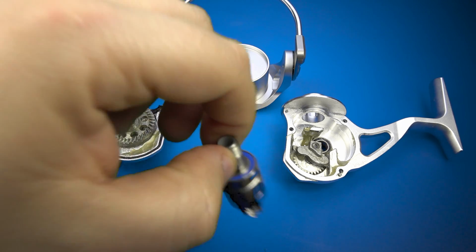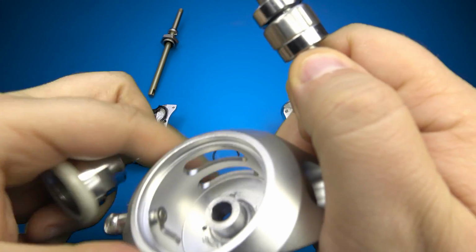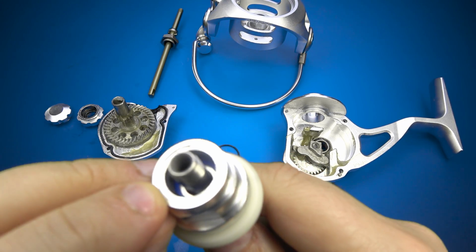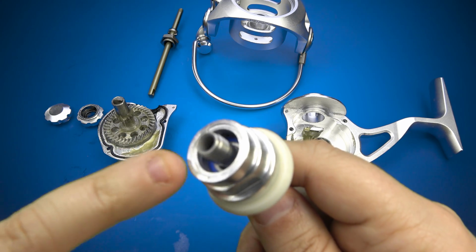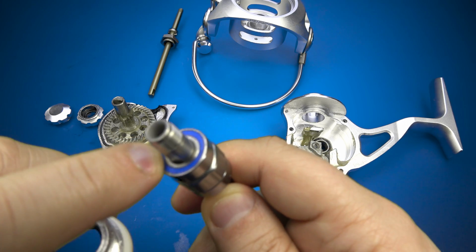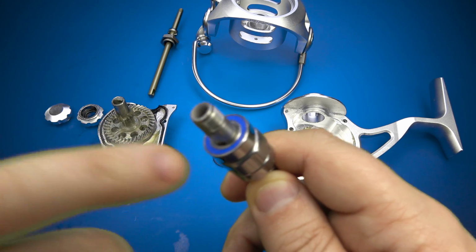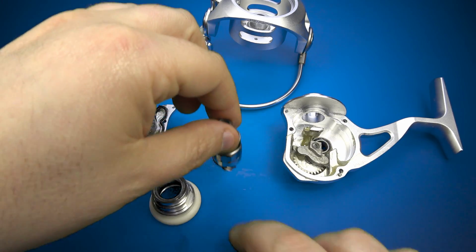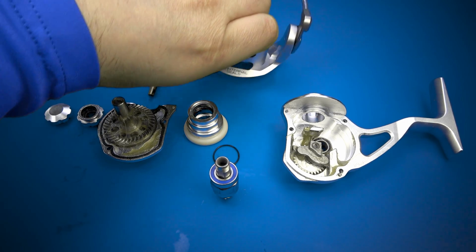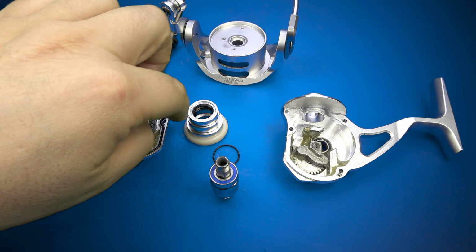3, that at the top, let's go ahead and pull this back out again. The bearing is virtually flush with the top, and it relies on the seal of the bearing along with the rotor being bolted down to that inner race and relying basically on the rubber lip seal to keep water out of the clutch in that bearing. The issue that I've come across personally, the seal didn't hold up. I had corroded pinion bearings. Never got past it to the clutch, but the bearing needed replacement.